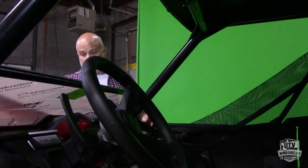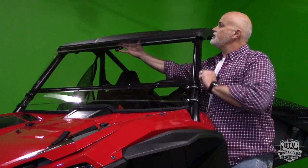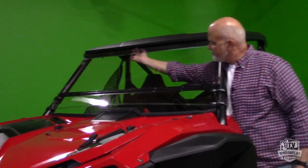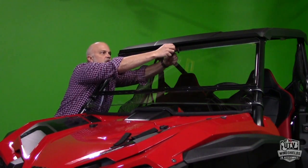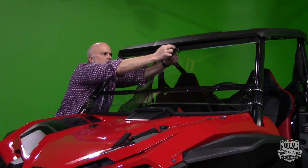Now that we've got that done, remove the protective coating. I'm trying to get the windshield up as high as possible, so I made it a little bit higher in the roof. You just need to put a little pressure up as it goes down and you're set. Your center support bracket — you want that to go in first because it's actually going to push the windshield out slightly off of the roll bar. It's very hard to connect this with the windshield in place. It's easier to connect it off the passenger side because the bracket is moved off-center that way — it's a shorter distance.